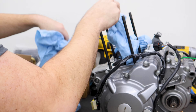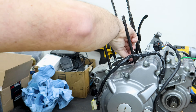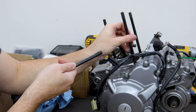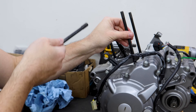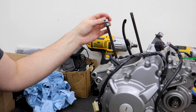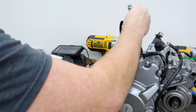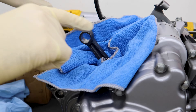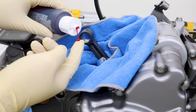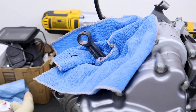Over on the engine, I'll set it roughly to top dead center. I went ahead and ordered new head studs — I was told you really just need to replace the nut and washer, but these were pretty cheap so I got a whole set. To get them off you put two nuts on and jam them together, that old trick. I've stuffed some clean rags down in here so we don't lose any parts, and I'm going to put a thin layer of assembly lube — just a thin layer, you don't need to glob it on.